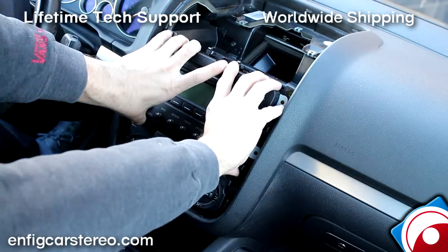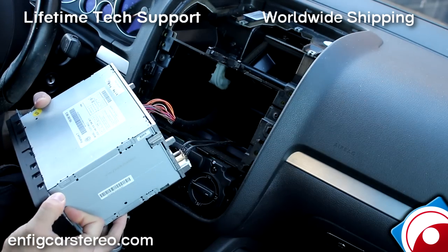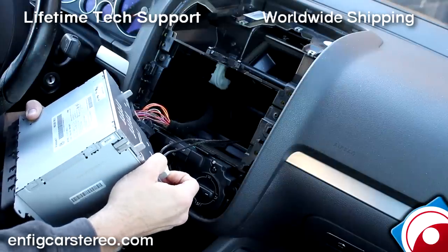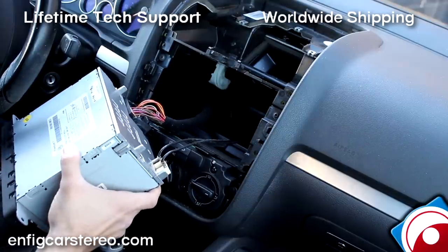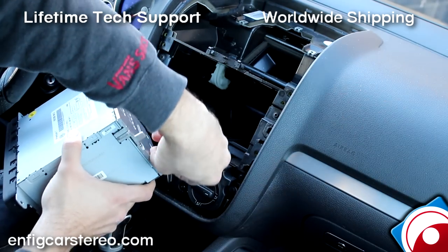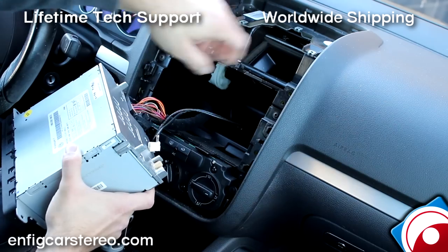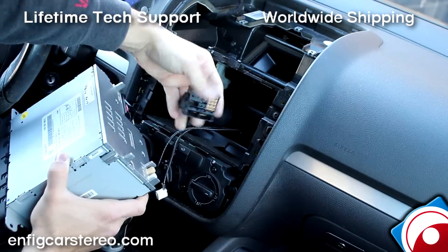So that's pretty much it — pull out the radio. Once you get to the back, you're going to have two antennas. You're going to push on the bottom and wiggle it out. In 2006 you just push on the bottom and wiggle out. Notice I have my finger on the shifter so it doesn't scratch anything. Some of the new ones have a locking tab that's different, but this one is just squeeze and pull. On the other end, all you're going to do is squeeze these two together and pull this out — it comes out just like so.